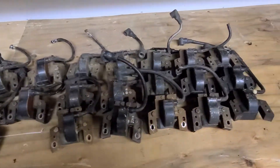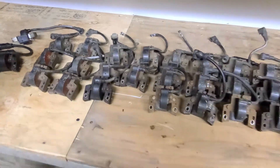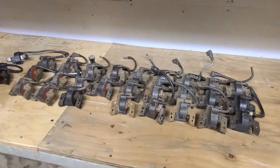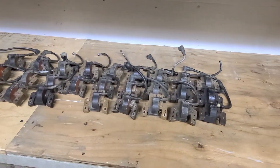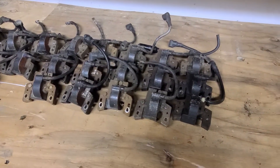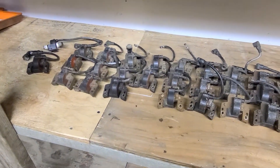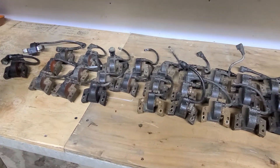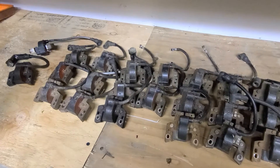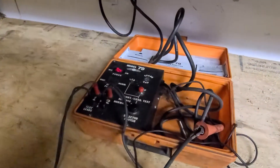I'm going to go ahead and test all these. I'm pretty sure they all work — like I said, I would have fired the engines before removing them. But if you ever run a small engine business, it's a great idea to keep a bunch of these on hand — maybe five to ten per season depending on how many mowers you work on. You'll get the odd mower with a bad coil: you'll think it's the carburetor, or the spark plug, or even the flywheel key — no — then you change the coil and the machine runs like new.